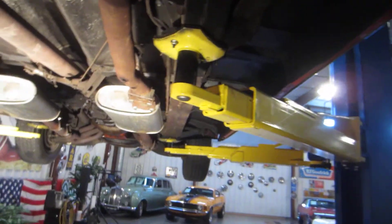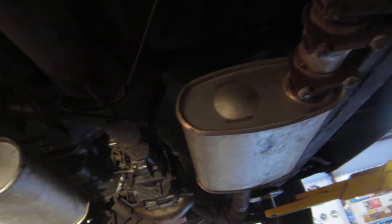The car has got a few little patches done in a few different places, but other than that it is a pretty solid car. Most of the cross members are in really good shape. The pans on the passenger side are in super nice shape, while the driver's side has been patched. Also, over here on the passenger side, this very front quarter right here has been cut in — I missed that earlier. So this has got new metal here, but everything on the other side of the frame is all original and looks really good. There's been a bit of body work done along the lower edge, but the back is all metal — they cut out the old stuff and put new quarters in.